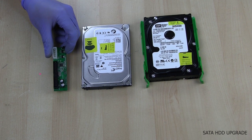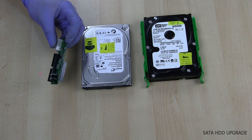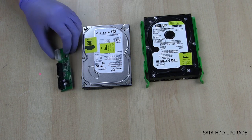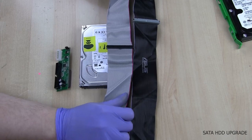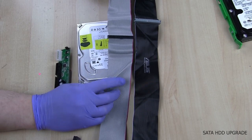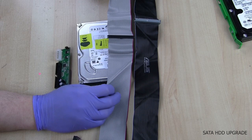If you choose a different board for SATA to IDE, be sure to verify it has a master and slave jumper on it. We'll need to connect this to slave initially so that we can use Chimp to copy from our master drive over to the slave drive. The Xbox has a 40 wire cable typically, and you can tell the difference between the 80 wire and 40 wire IDE cable by how large the wires are on the 40 wire cable compared to the 80 wire cable.